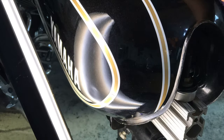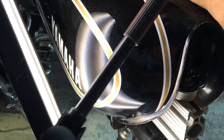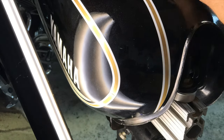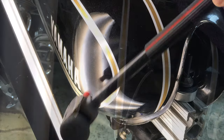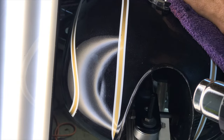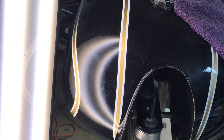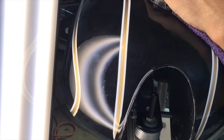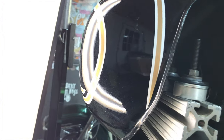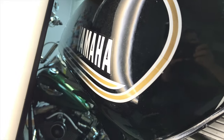We've moved to the right side of the tank and we're starting to shape out those two little knuckle prints. I'm using a blending hammer — we're basically taking down the high spots around the perimeter of the damage, remolding and shaping it back to that perfect curvature so there's no dent left. We just finished fixing that little pencil eraser dent and we're repairing that crease now. There is a little bit of paint damage on the front side of the tank, but it's pretty minor — the customer was mainly concerned with the dents and keeping the original patina on this tank.